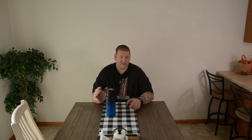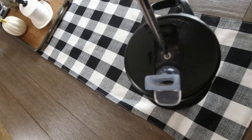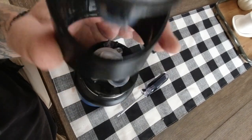First thing you're going to need to take this apart is a trusty Torx bit. You're going to need a T10 Torx to go ahead and unscrew this right from the very top, pull the cartridge out slightly, unscrew the cap, and then lift the top of it all. There are also two more Torx screws that you need to take out right here on the top, and for that you need a T9.